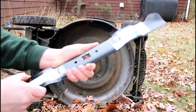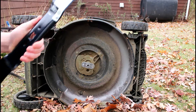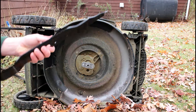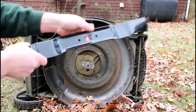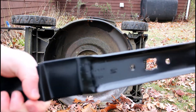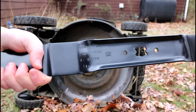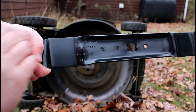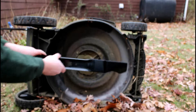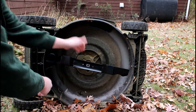As we do that, we now have the blade out of the packaging and we need to take the safety warning stickers and display stickers off too. Now that we have those off, we can start to install it. First thing I want to show you is on the replacement blade it's going to say right here in the center that this side is towards the grass. That's important to know because you want to make sure that the rotation of the blade is correct. So if yours says that, make sure to follow it, and also reinstall the same way you took it off.